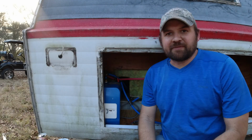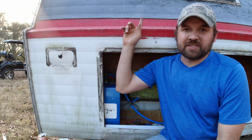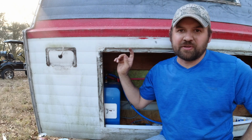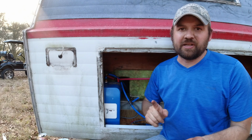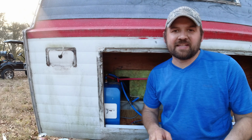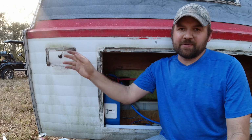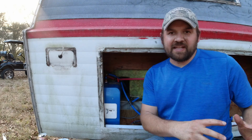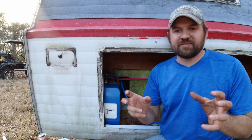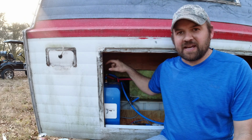All right, so I think that's going to be it for the day. This is really just part one. So what I've got so far is I've wired up the back lights. They're on the top. I have not wired in the brake lights yet. So as I showed you earlier, the top lights are wired in. The positives are individually wired, each light, and then the negatives, the grounds, I ended up grouping them together. I didn't run so many wires down the chase, down this side of the camper. So I wired the two ends together, and then the middle three, and then the other end two together. And so I brought them in, and they're all down here and ready to be put together.